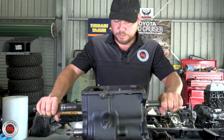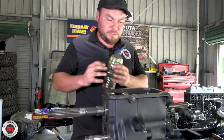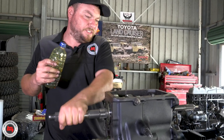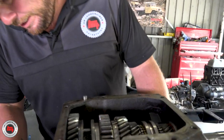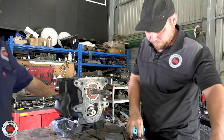Ready to reassemble. Once you've got this bit out of the way we're cruising. Those bearings are all home — just going to lube up, show it's all in there for when it first starts moving. We'll get the bearings in the lay shaft now and lift it up in place. That's the bottom bearing on the front of the gearbox. Now, the race is actually part of the lay shaft — so you see the bearings, they're open, it's like an open needle roller.